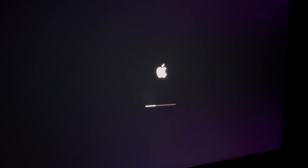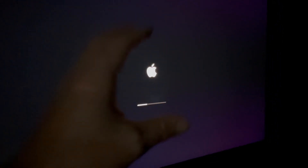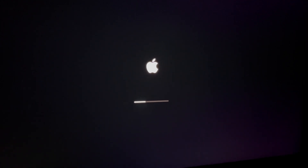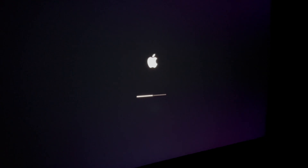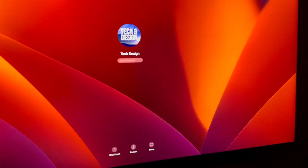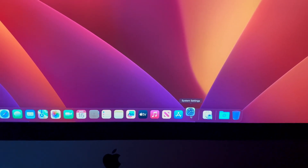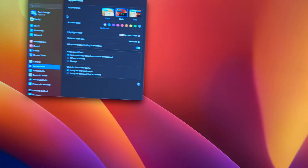Once you set up the external hard drive, go ahead and make a backup. That way if you have any issues in the future, you won't have a problem resetting your whole Mac, because everything will be backed up on your external hard drive with Time Machine. Making the backup now will actually back up everything from your internal hard drive, not just your external. Right now we're logging in — your Time Machine option will be right here under Settings.